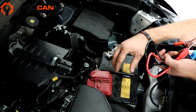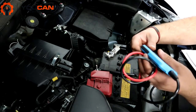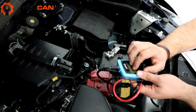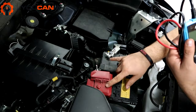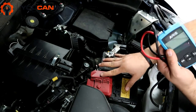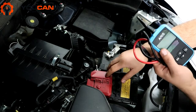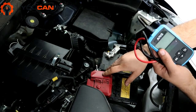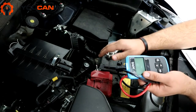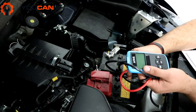So let's go ahead and make sure that the battery is good. What you need is a battery tester. A battery tester works way better and is more accurate than a multimeter, because a multimeter is always going to tell you the voltage, and sometimes that voltage could be low because the battery is discharged but doesn't mean the battery is bad — you could charge it and the battery can just work and operate normally. A battery tester, even if the battery is partially discharged, will still do a current draw and measure the voltage to tell you if you have a good or bad battery.